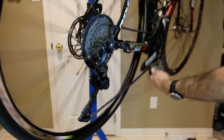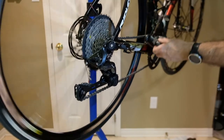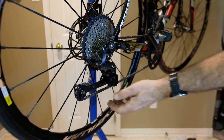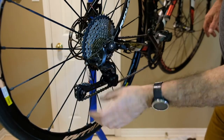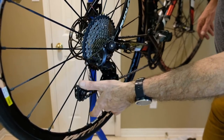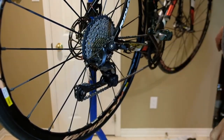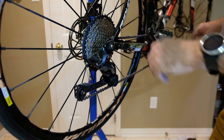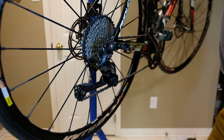Work our way down the gears quickly — all the way down to the bottom, so now we're on the small-small. Even though you wouldn't typically use that gear, it's worth noting that there's still some tension in the cable. With the previous derailleur at this point, this chain was engaging into the upper jockey and there wasn't enough chain take-up. So you can see it solved the problem. Pretty happy with this setup moving from road gearing with 50-34 to an 11-42 and swapping on a mountain bike rear derailleur — it's working nicely. It's going to help me get up some monster climbs in Cuba; Grand Piedra for example was something I could not do with the 11-32.